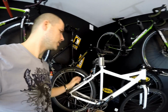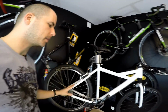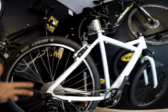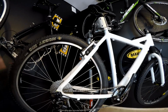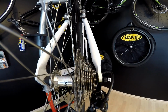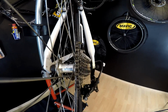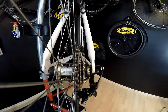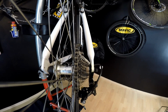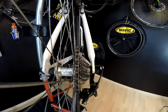When pushing some very steep hills, I would anyway prefer to run a little bit, so this is just fine. And with 38/11 you're able to go quite fast down the hill. Let's look at the chain line. This is the chain line for the highest gear, and this is how the chain looks for the lowest gear. So as you can see, it does bend from the narrow wide chainring into our lowest gear.